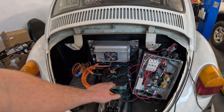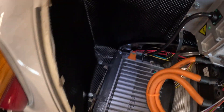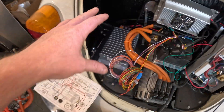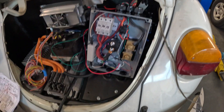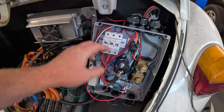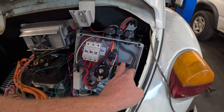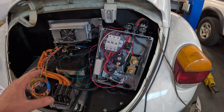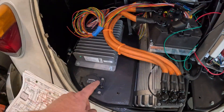You can see the motor in the middle. This is the charger, which I've got bolted up to the firewall. This is the DC to DC converter over here on the side — it provides 12 volt power to the battery and the 12 volt systems in the car using the main high voltage battery. This is the contactor box: you've got your main high voltage relay, the shunt which measures the current in and out, and up here are fuse blocks — fuses for the charger, the DC-DC, and other high voltage circuits. This is the relay which, when you turn the key, connects and tells everything to power up. Down here is the controller for the J1772 charge port.